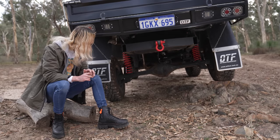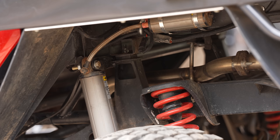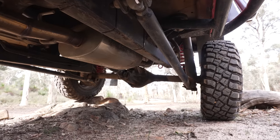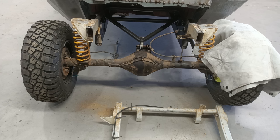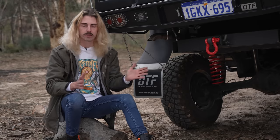I've got coilover springs in there that fit nicely into the stock Vitara coil hats. I got BP51 shocks with that mounted on the front control arm, so there's a good amount of travel on them. Custom triangulated three link in the back, so long arms on the front, they're about 1.1 meters long with a decent like 400-500 long triangle piece in the rear to really get the flex going and get rid of the panhards so we don't get any side travel on there.